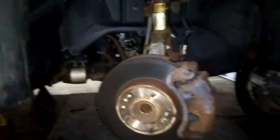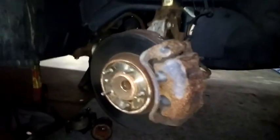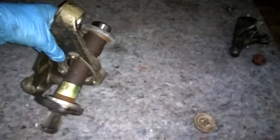I just pulled the front transfer case. Found some directions on AutoZone.com that kind of help you get there. You'll pull your axle out, and then they claim number 7 on their list, you need a special tool to remove the little half shaft there. You don't. Take all 6 bolts out of it. This will slide back, and then you can clip some vice grips on it and tap it with a hammer. I think I got a video of it somewhere.